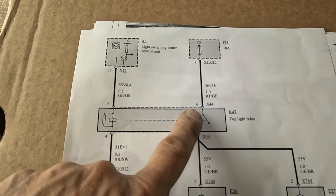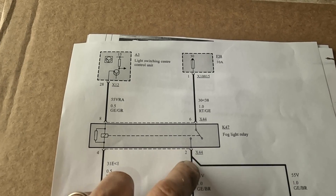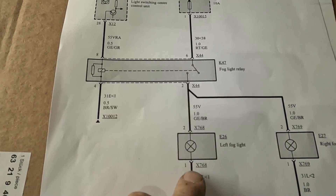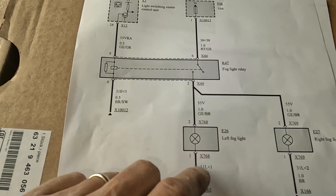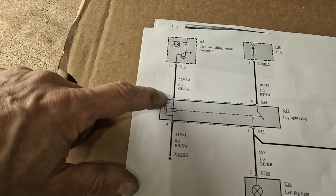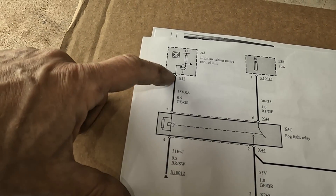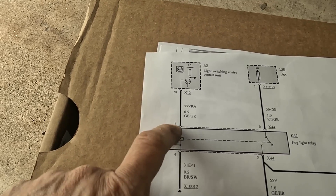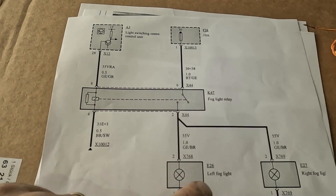The next step is to check the relay. There's a lot of things we can check: we can verify that power is getting to the relay correctly, and check for power on the output side. If there's power leaving the relay from pin 2, we'd know we potentially have a ground issue or a wiring issue downstream. What's cool about the relay is we can check for power from the control module and check the ground. I can also supply power by back-probing at pin 8, and with the relay installed it should close and my fog light should turn on.